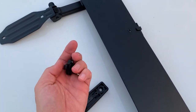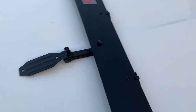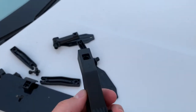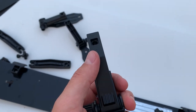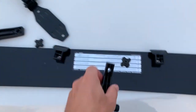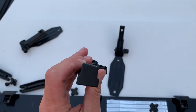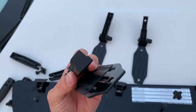From underneath, just install the nut and get all three mounts tight. One thing to pay attention to: those three mounts are actually different. The center one is marked with a C and it's flat. The L mount is sloped to the left side where it contacts the wind deflector.